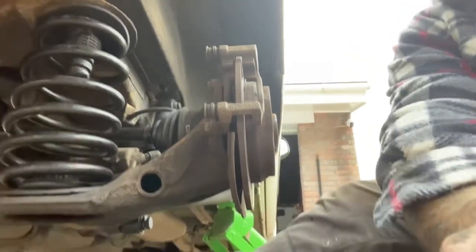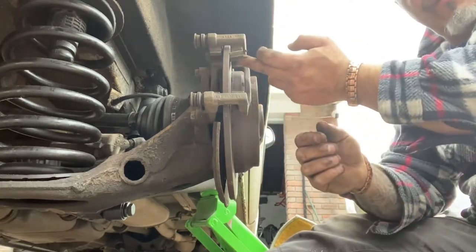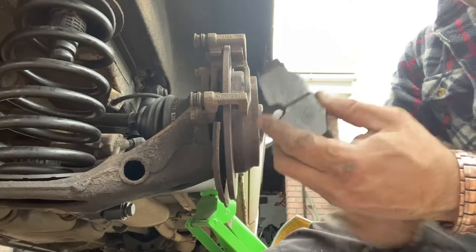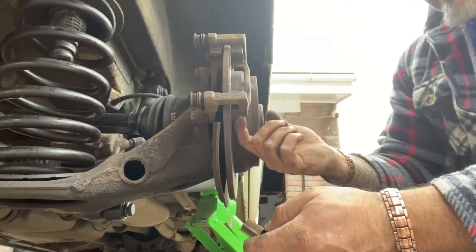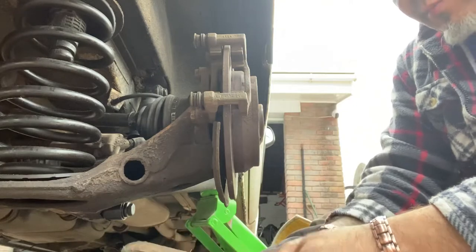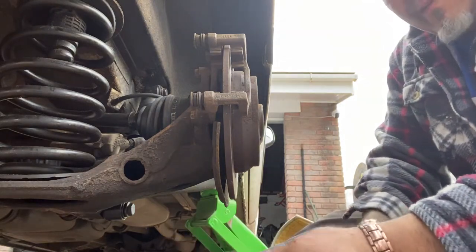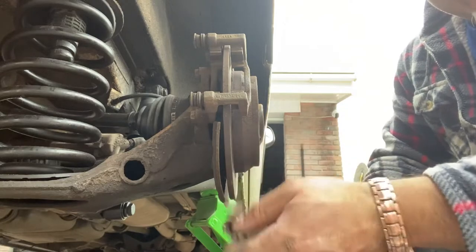We're back now - the carrier is on. These are what your brake pads recess into. A normal mechanic won't do what we've just done - I've gone into my little workshop and given that a machine brush so it's got all the rust and gunk off it. You can do the same with these with a wire brush. They don't have to be perfect or spotless - just clean them up. You can see a time lapse on this.